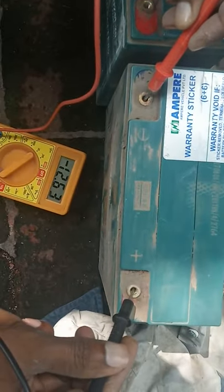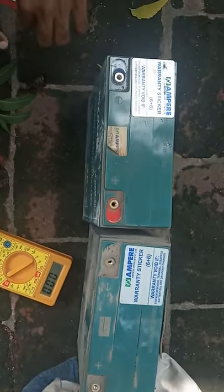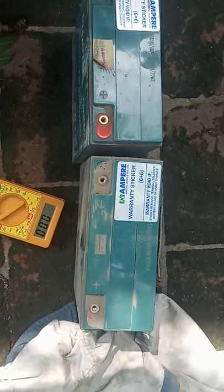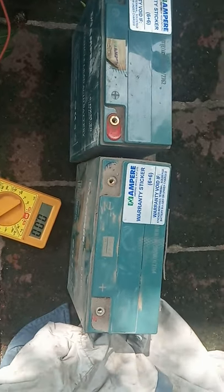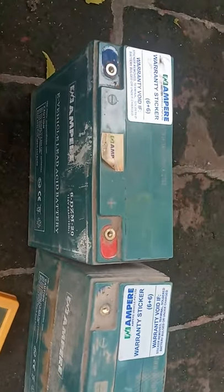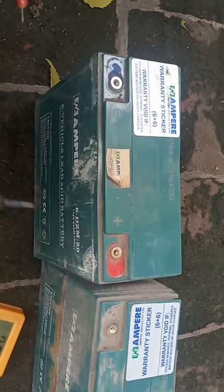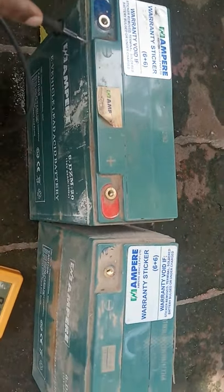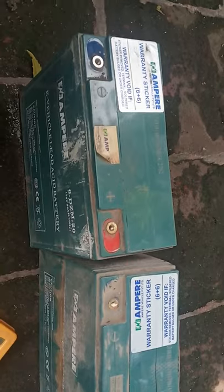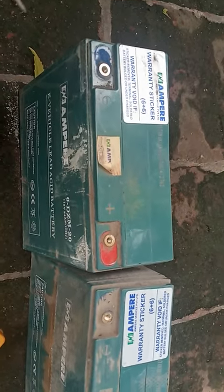One battery shows 12.62V. It is important to rotate the battery positions — we didn't rotate ours. These batteries are 3 years and 3 months old. What we used to do is wait until the battery dashboard shows around 47V before placing it for recharge. Don't recharge your battery before it comes to a low voltage level. If you technically know how, you can rotate the batteries — it is good to rotate the first and last battery, and also rotate the batteries in between.